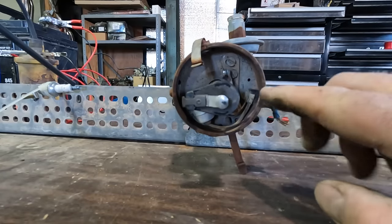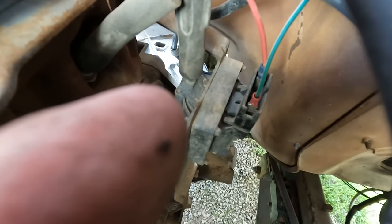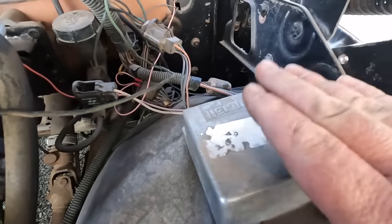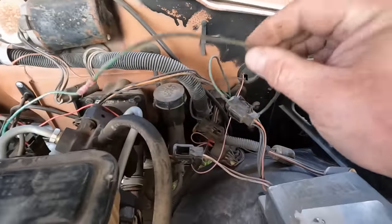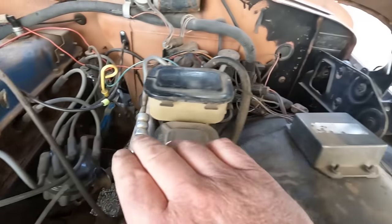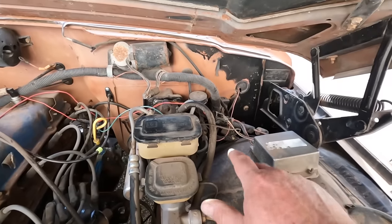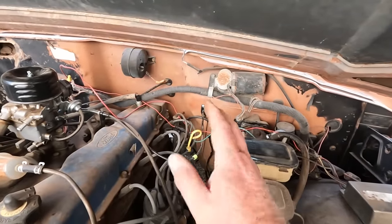They replaced points with an electronic switch somewhere around the 70s, but they work under the same principle — add power to the system. Here we have the Ford-style ignition system with the coil, where the positive is just keyed ignition power and the green wire signals to trigger the coil. That green goes to a Motorcraft DuraSpark-type module with a lot of wires. The other wires go to the switch in the distributor — a sensor that does the same thing as the points, sending a signal to fire the coil. This module does have a power wire, so I put a low-amperage fuse in it just in case.